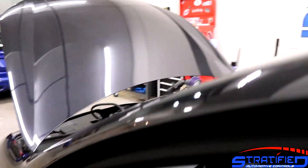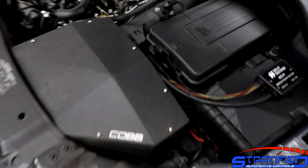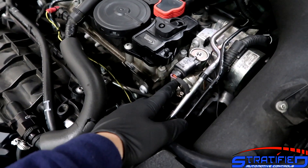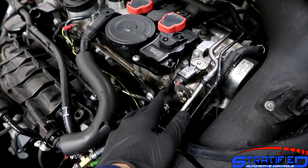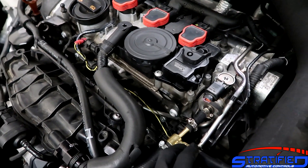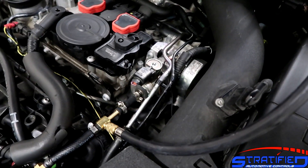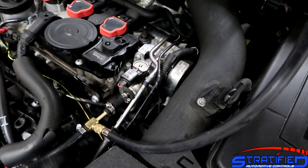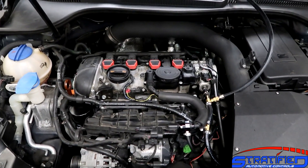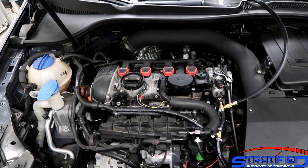One other caveat with these testing kits: the Mark 6 actually has a very easy barb connection. Some other cars don't have a barb connection — they can have a clip connection or a push-on connection, and those would most often be 5/16 fittings and so on. So look at the kit you're purchasing and make sure it has the right facilities for that kind of connection. This will give you an idea of how your low pressure side system is coping with the power levels you're at.